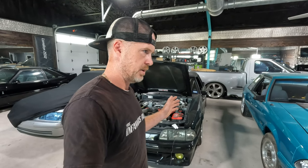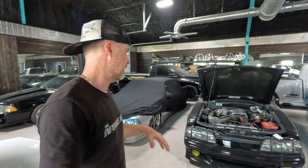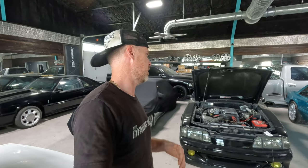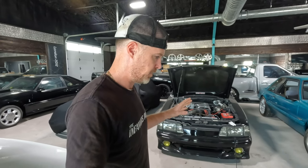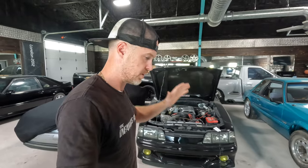And the throttle response isn't 100% there just because it's most likely looking for things off the EGR and all of those other lovely sensors that I've removed. But once the car gets up to operating temperature, there's no issues. So the car runs, drives, it does not stall. It idles great. It's got the blower, it's got GT40 heads, GT40 intakes, an E303, full exhaust, and runs and drives great with all of that stuff missing. Just throwing that out there.